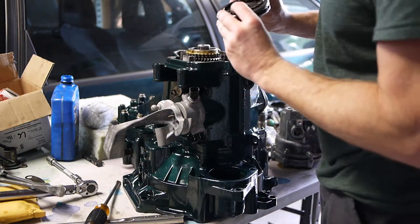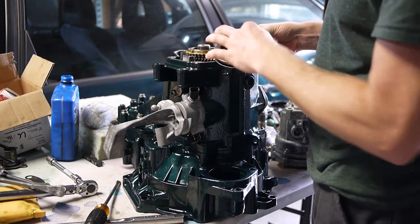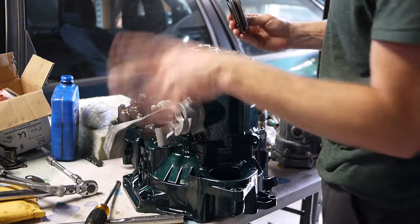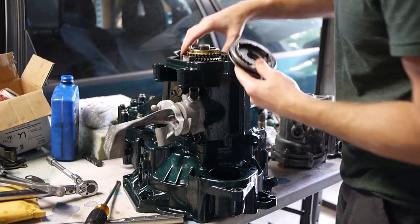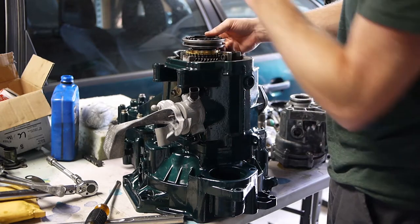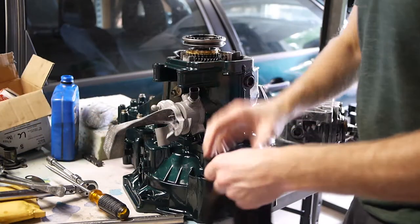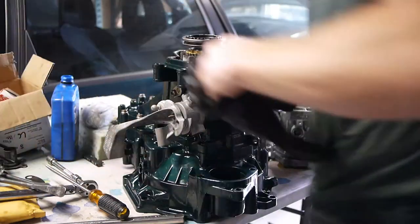And the operating sleeve. I already did this once and pushed on it accidentally, and all the little locking pins fell out. And I had to go chasing them all over the floor. It was ridiculous. So what I think is going to work here is simply to heat this up, be very careful about where these are, and then hammer it down with a rubber mallet. So I'm going to go ahead and heat this thing up. I'm going to put on something other than skin, because skin burns when it gets really hot.